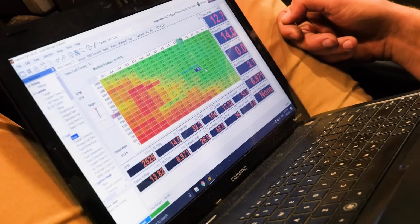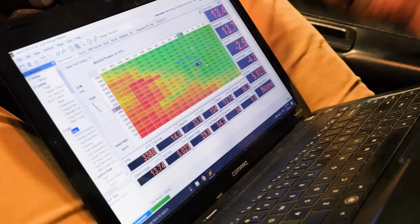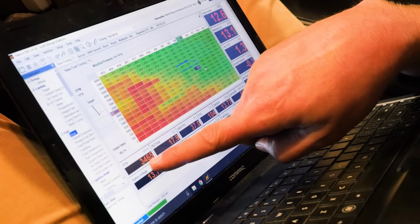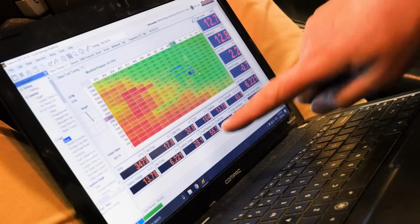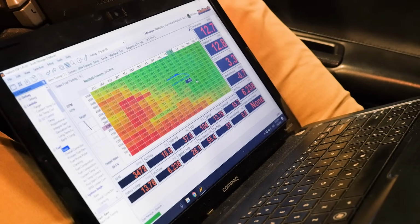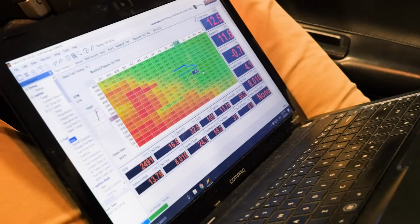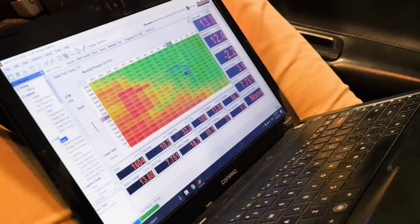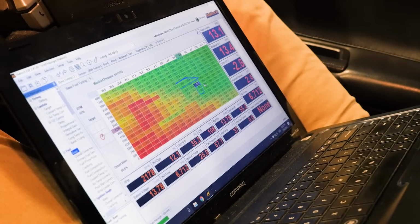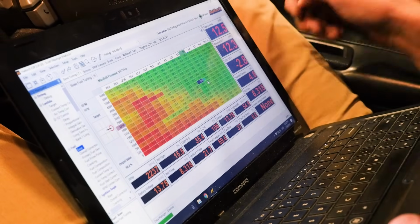So I'm just going to let more and more, and I'll let the dyno come up to now 125 kilometers an hour. And now I'm up at nearly 3,500 RPM. I'm going to leave the same throttle position, but I'm going to bring the dyno speed down and down and down. So let me bring the, oh, you can hear it dragging us down. Same throttle position, or I'm trying. Up and up and up. So now I'm stuck or locked at 2250 again.